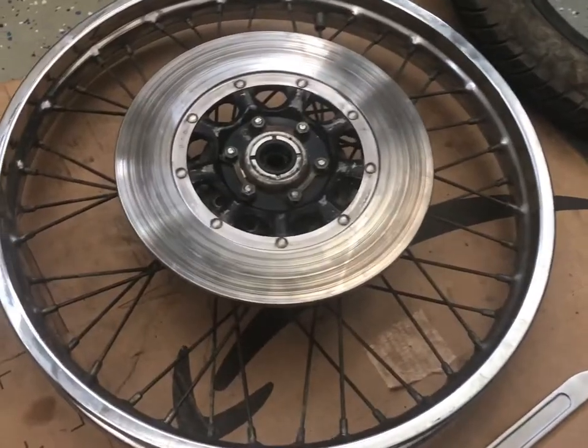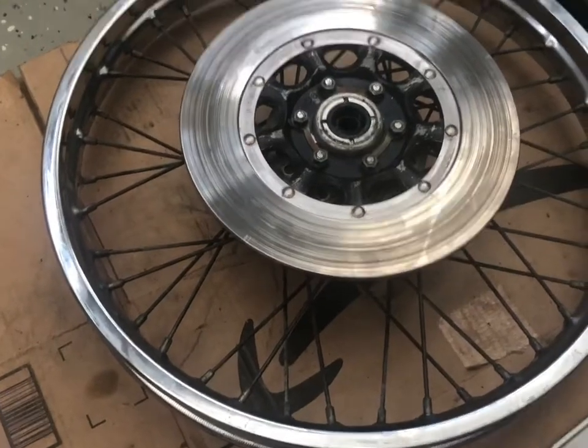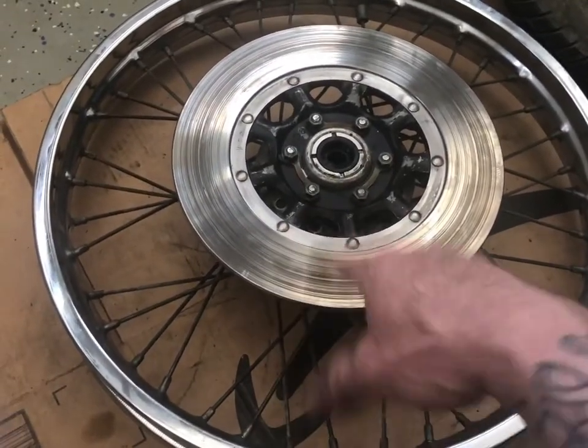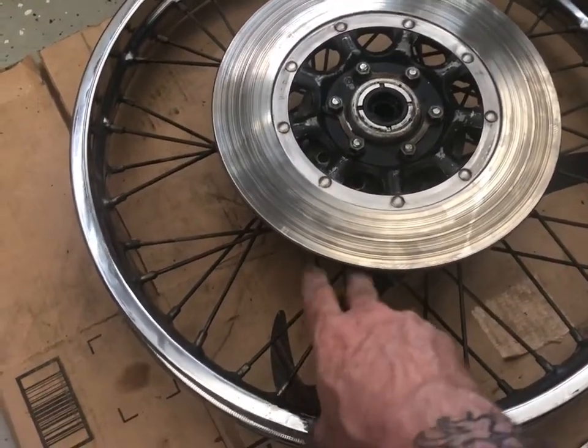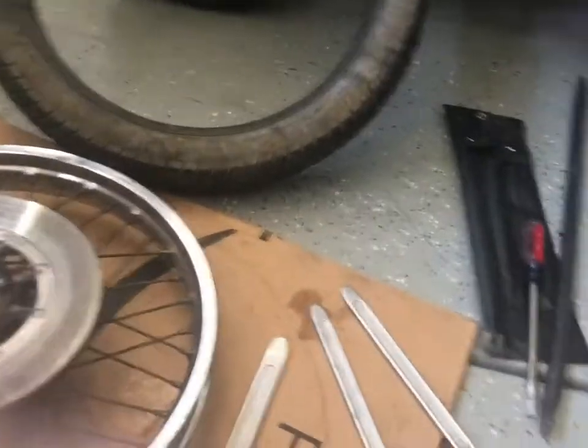But a 1981 Kawasaki KZ440 has a mag wheel, and the shop manual does say you have to use a tube on that, so I don't know what that's about. But in general, a good rule of thumb is if they got spokes, you have to have the tube. And if it's a mag wheel, the kind with the metal instead of the little triangle shapes, then they're not gonna leak, I guess. So they don't use the tube. The new tire we got's right here. This is gonna be a front version of what I just ran on the back one.